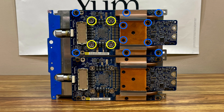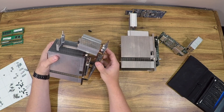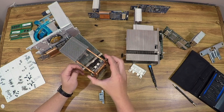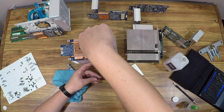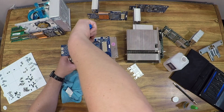So I took the processors from my Delphi liquid cooling system. Removing the processors is pretty straightforward — each has 10 black screws plus four screws around the processor. The passive heat sinks on the processors from this actual computer were too short and wouldn't fit onto the air-cooled heat sinks, but the passive heat sinks from my unit were longer and fit perfectly. So I attached the donor CPUs to the air-cooled heat sink. Not all the screws were compatible, but enough were to secure the processors to the heat sink in a way I was comfortable with.